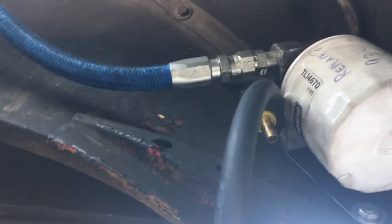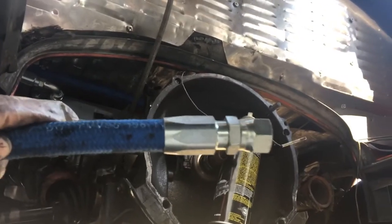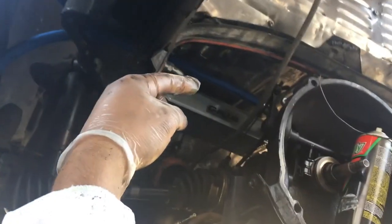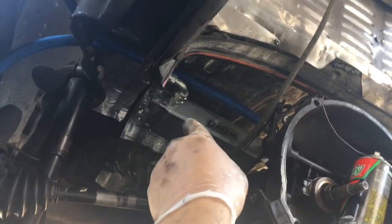To give a general overview: oil comes out of your oil pump, follows up behind the tire, through into that fitting, gets cooled inside the oil cooler, comes back out, goes into this filter, before coming back out and going into the block.